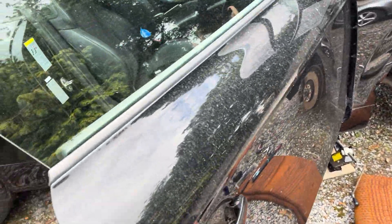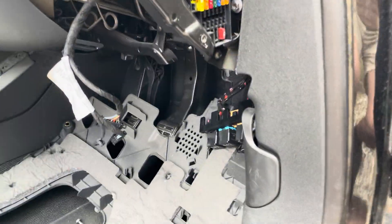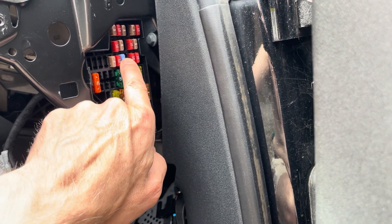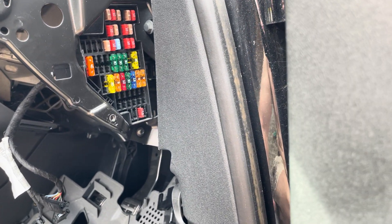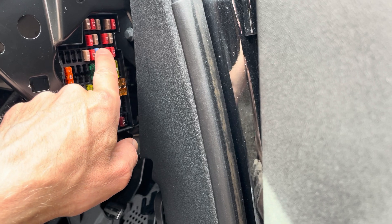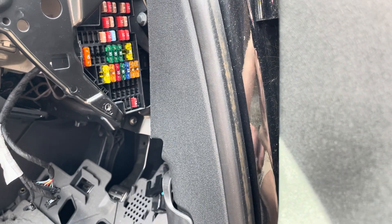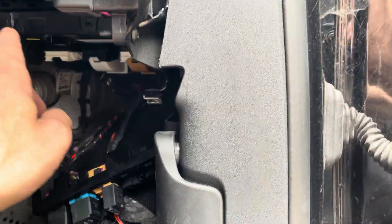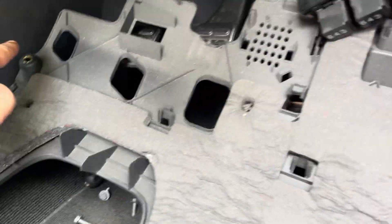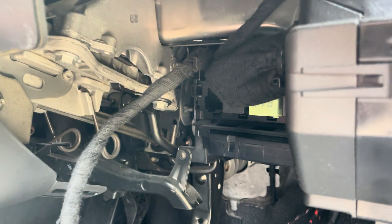I accessed the BCM, which isn't too difficult. It's up underneath the driver's side dash — the fuse panel is here. I took all the fuses out and was adding them back one by one. When I added in the 15 amp fuse here with the rear fuses all disconnected, that's when the current draw increased beyond a couple of milliamps — staying at about 80 to 90 milliamps with that fuse in. Looking at the wiring diagram that goes to the body control module, which is this block with three large multi-plugs in the bottom.